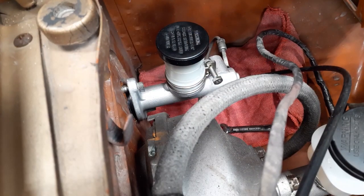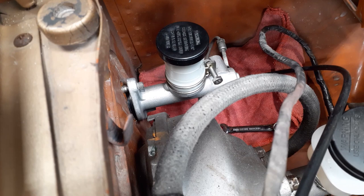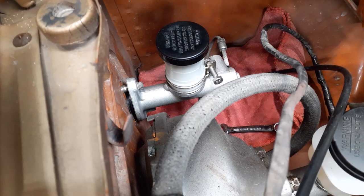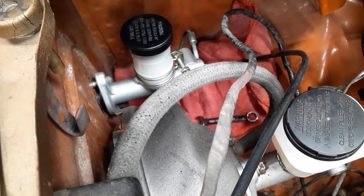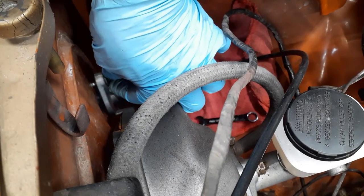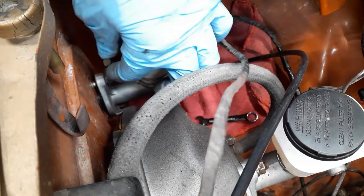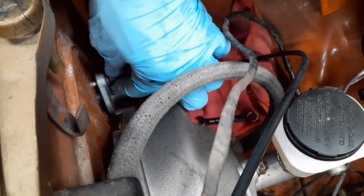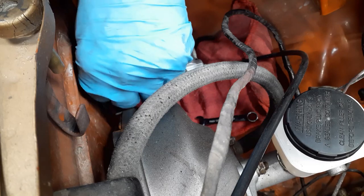What I want to make sure about, I'm going to go inside and make sure that the yoke is on either side of the clutch pedal, because if it's not, that's going to make for difficulty operating. And after wrestling with the clevis pin for a couple minutes, I realized one of the things that probably helped me out here is if I had the master firmly against the firewall. So that's what I'm going to do. Get myself that extra quarter, half inch or so,